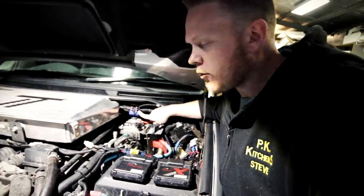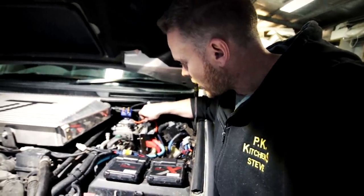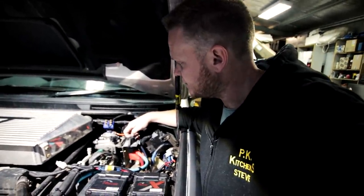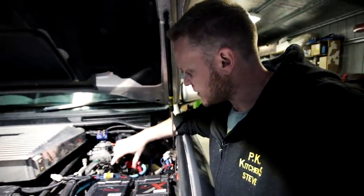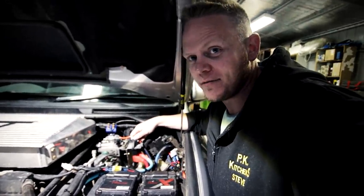Up in the corner I've got my onboard diff breather kit — transfer case and everything else on a four-block. I had one spare spot, so I've hooked my winch breather up to it as well, running it all the way up to the highest point I can to keep the winch breather out of the water. Also as high as I can, I've mounted the key for the on/off isolator — mounted it to the side of my air filter with some tech screws. Yes, I'm gonna get chewed out for using tech screws. It's got a little cap to keep it clean and tidy. Keep the key somewhere in the car — guaranteed someone's going to say, 'Now I know how to break in and winch your car in half!' Watch the comments.